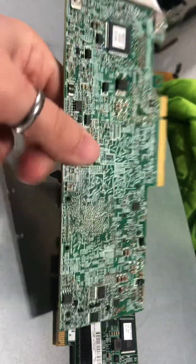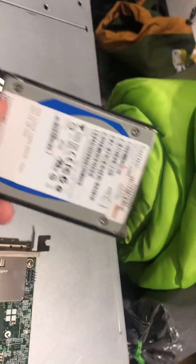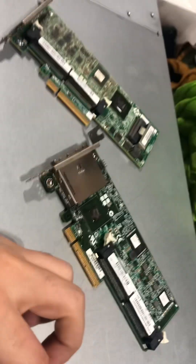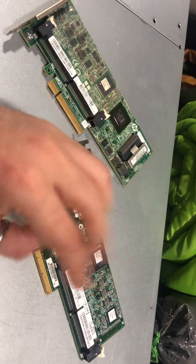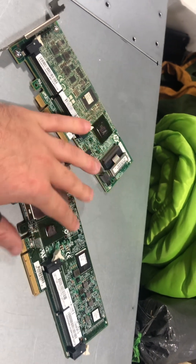Back onto the subject: for home lab environments, these controllers are very easily going to manage SAS 2 and SAS 3 SSDs — for example, these ones right here, which are SAS 2. So both the P420 and P440 would easily manage these. If you have a very small home lab where you are using one or two SSDs for cache, or as very fast storage for a database or a critical virtual machine, do not hesitate to use it. Even though it will be close to saturating a lane, I don't think that in a non-production environment you will have any troubles with it.